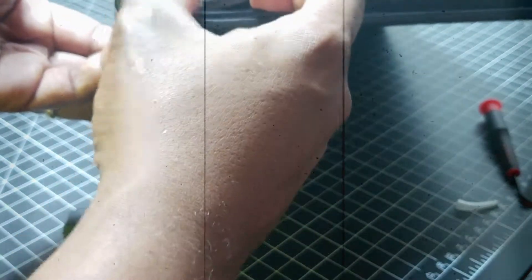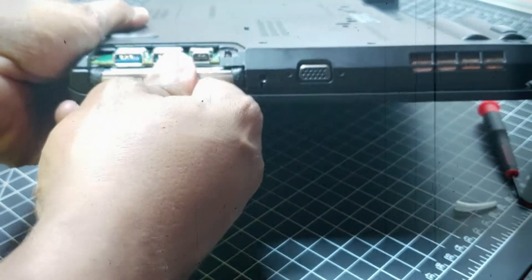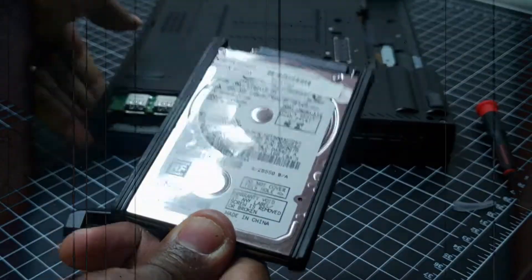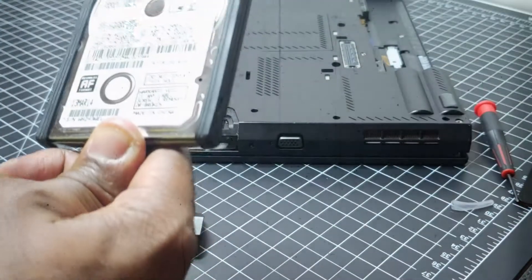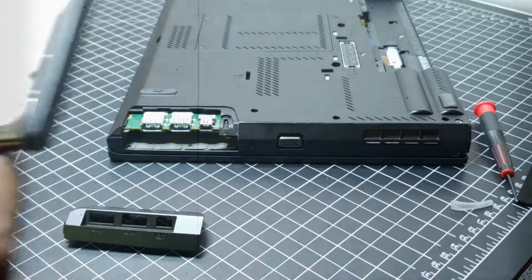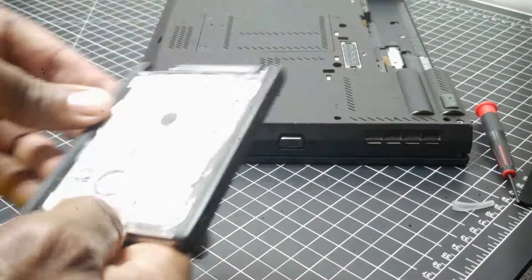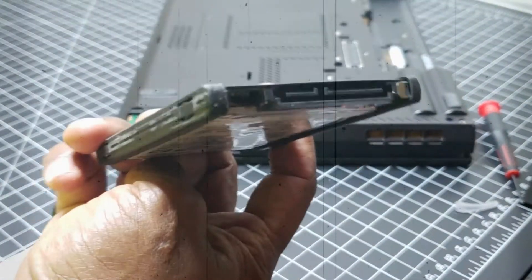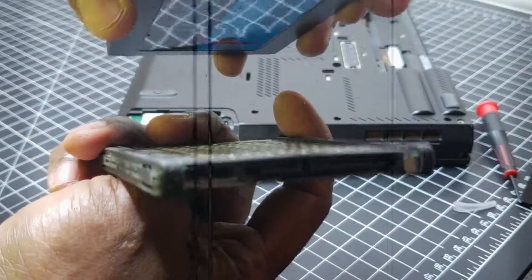When we put it back in there we're just going to put it back in the exact same way - pretty straightforward. Just pull your hard drive out. So that's the hard drive - like I said it was a traditional hard drive, nothing special, 500 gigabytes. Now we're going to see which way the pins are, which is pretty straightforward - these pins should match up, same connections.